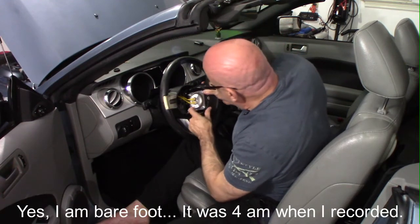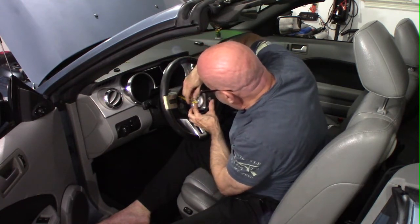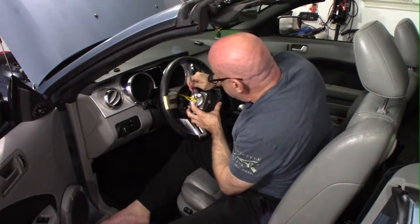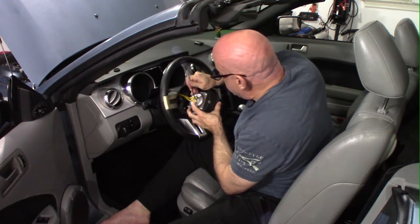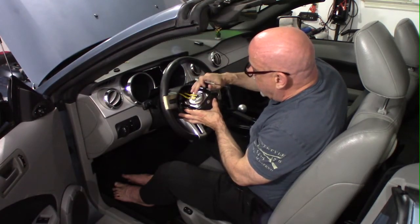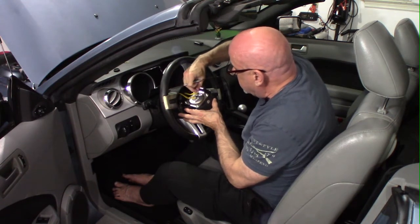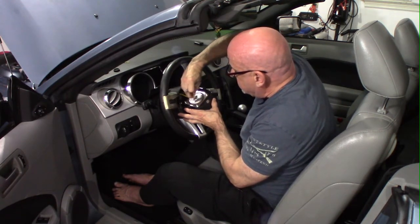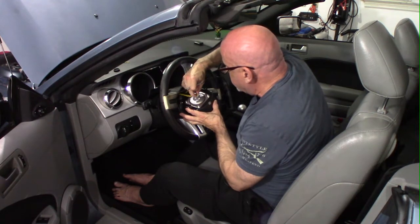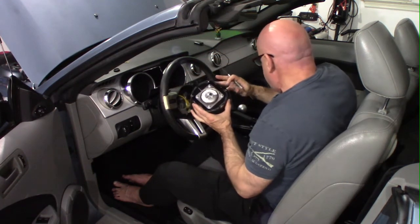As you can see, there are two clips to the clock spring. On this particular side it looks like there are two releasing tabs. There are two plugs, and there are two tabs on each of the plugs — if you squeeze them in, you should be able to unplug each of these. They are keyed slightly different, so you will not be able to put them in wrong when you put it all back — that's a definite good thing.